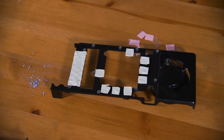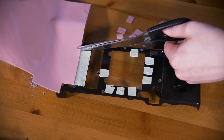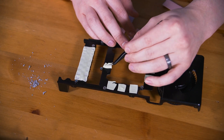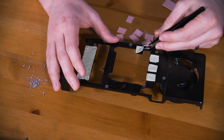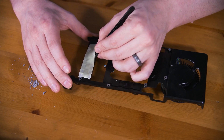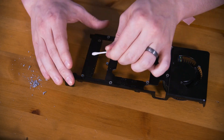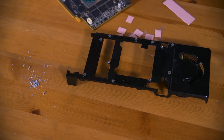Once everything is nice and clean you can get your new thermal pads ready. Unless you've bought a kit for your specific card you will likely have a large pad like the Arctic APT 2012 or the 2560 pads. You'll need to make sure that you both cut it to the right size and use the right thickness — the same thickness as the original pads. In this case the original pads were one millimeter thick so I'll be using one millimeter pad material. You can basically eyeball how much material you'll need based on the existing pieces, or if they're not in good enough condition to use as a reference, base the size on either the cooling plates or just what components are going to be cooled by them.